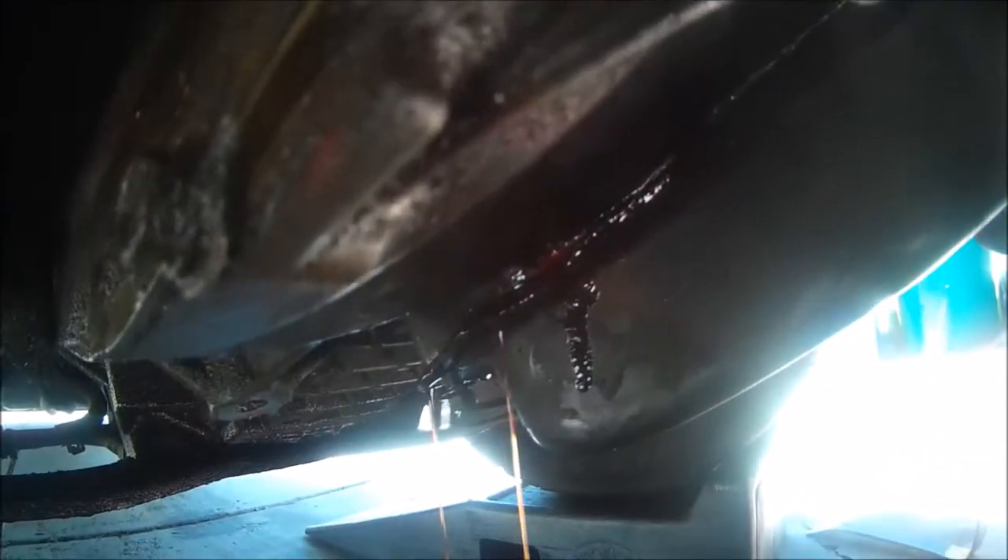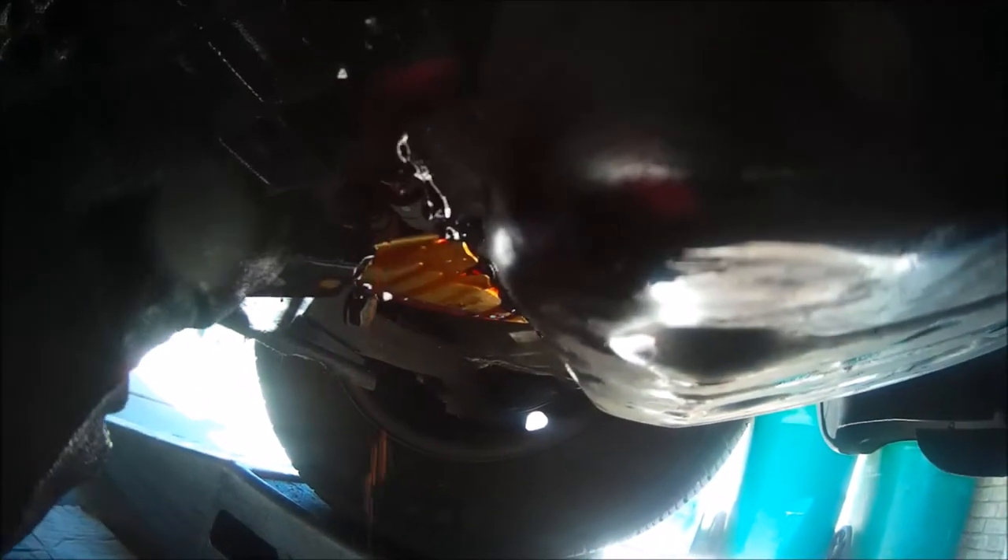Once you break the seal it's going to start leaking — it'll drain really fast once you open this pan. That's why we left those two front bolts in. Just crack the back two bolts, and it will drain nice and slow. Take the putty knife and slowly run it along the edge of the seal, beginning to remove the glue. Once one corner is removed, take that bolt out and slowly release the pan from that corner.